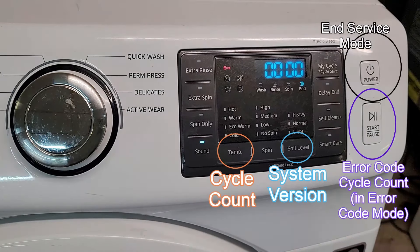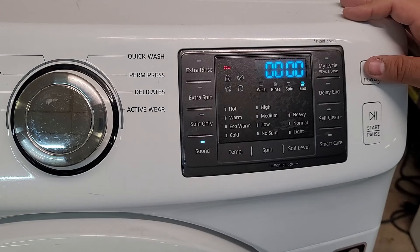The mode will need to slow down and drop RPMs to zero before you can open the door. Other commands available in service mode include: cycle count, which shows how many times the washer has been run since purchase; the software version button, which displays system information; and when in error code mode, you can hit the Start button to display how many cycles the washer has done since a specific error code appeared. This machine had no codes, so that last feature wasn't very useful. To exit the mode, simply press the power button.